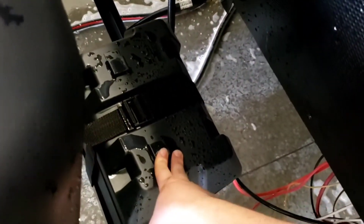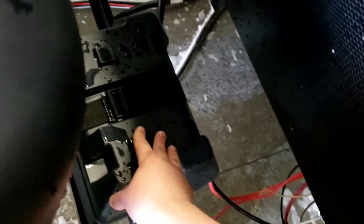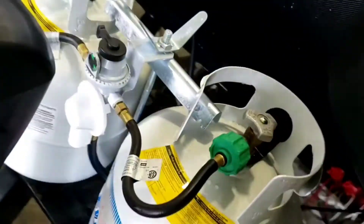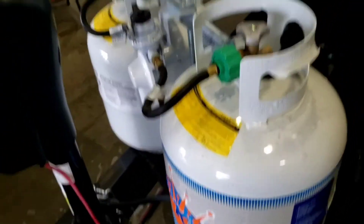Group 24 RV/marine gray battery — brand new. In winter, I recommend taking it out completely and storing it somewhere warmer than outside. I also recommend disconnecting the negative lead if it's going to be a long time between trips so nothing's draining your battery while you're away.